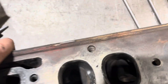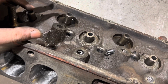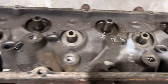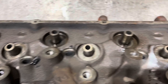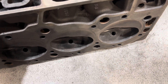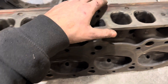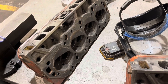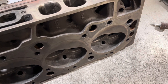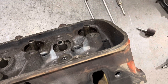Next video I'll install all the valves, guides, and all that — the guys are already in there. I'll do the whole head build. I am using factory valves, but I've got new springs, retainers, 10-degree locks, new posts, and girdles — everything. It's all Comp — a Comp cam with a 924-16 dual spring. That'll be all for this video. I'll catch you in the next one where we're actually putting them together. I might paint it before, or after, I don't know. Thanks for watching — feel free to like, subscribe, share, do whatever you want. Even dislike it — I don't care, the algorithm doesn't care either. Take her easy.